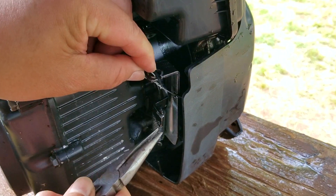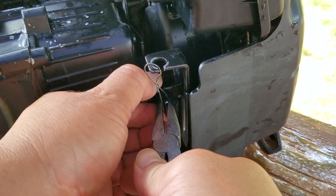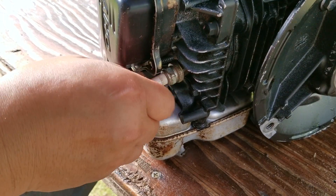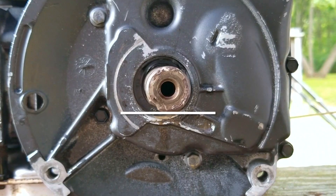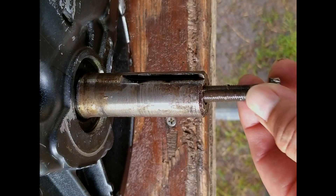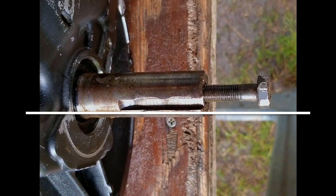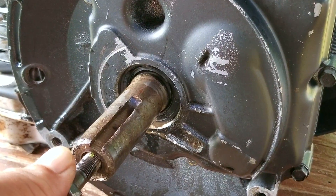After moving the crankshaft back and forth there seems to be a little more play in it than I'd like, but to get a better look I need to release the flywheel brake — and that's when things get a lot worse. If I'm going to have the brake off I might as well take out the spark plug so it'll be easy to rotate the engine and check whether the crankshaft really is bent. I'll put a line across the screen and use it as a reference point against the end of the crankshaft — that way when I rotate the engine I'll be able to see if it moves away from the line. It's a bit tough to see from this angle, but it certainly seems like it is bent because the end of the shaft keeps moving towards and away from the line. From the top it's pretty easy to tell: yes, the crankshaft is bent, and we can either choose to bend it back into shape or replace it.